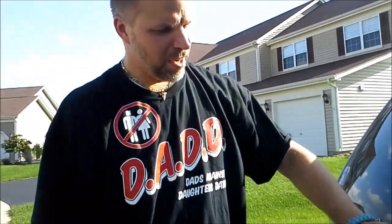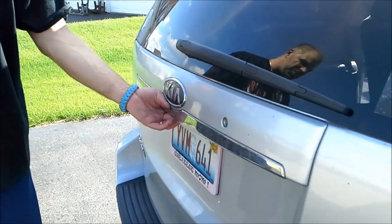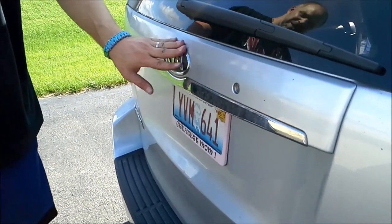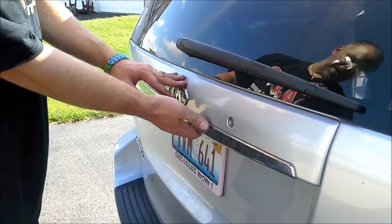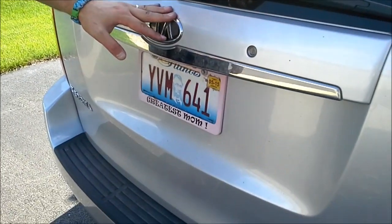What I want to talk about today is how to fix a 2006 Kia Sedona if you press the handle and it's kind of loose and doesn't do anything. Essentially what has happened is the spring is broken. You can diagnose that for sure, but if you use the key and fumble with it a couple times and then get that stiff handle back again and it only works for a couple days, the problem is that spring has failed.